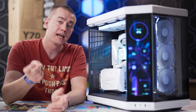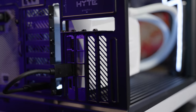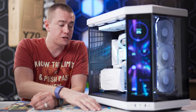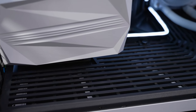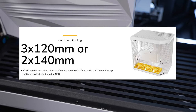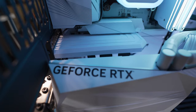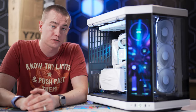I can run full clock speed on the 14700K without it interfering with the 4090's cooling. Hyte has configured this case to fit up to a quad-slot air-cooled card via vertical slots, and you get extra slot distance from the tempered glass panel for GPU breathing room. To help further, there's a fan basement below the main section that hosts some touchscreen cable management but also fits an additional three 120mm fans or two 140mm fans up to 32mm thick, pushing air past the GPU and out the top through the CPU radiator. Four vertical slots come with a matching PCIe riser that connects to your GPU, included with the Y70 — no separate purchase needed.